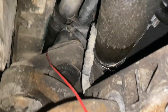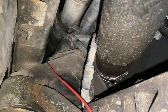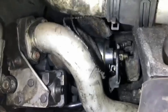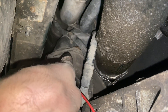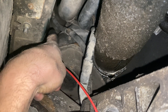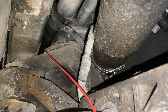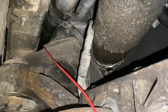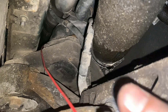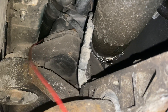It is not a fun spot to get at. I took my ground cable off. You're going to have to really look closely at the picture I'm going to post because I can't film this. That's your engine mount there and that's your turbo intake pipe up there. It's behind the engine mount, below the turbo intake. There's a little blanket over top of the solenoid — peel that back and you can feel a stud about that long with the cable on it. I've just got my clamp on there now, so I've got to put my ground clamp back on and then I think we're ready to do this.